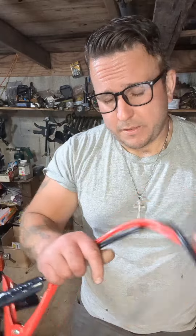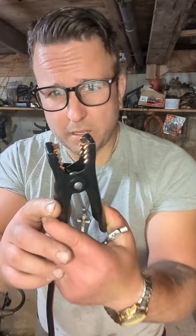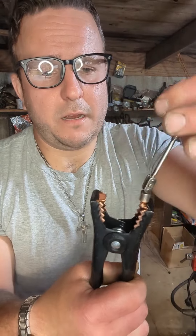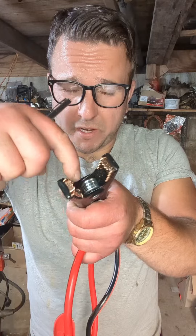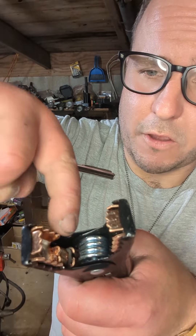This is just aluminum wire that's electroplated with a tiny thin layer of copper. The clamps here look like copper, but most people would think these are copper and they're not — they're just electroplated steel and you can stick a magnet right to them. After the first couple of uses they work pretty good and will conduct like 10, 20, 30 amps, but after probably three to five uses they won't work at all.